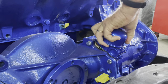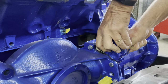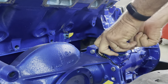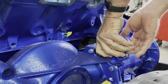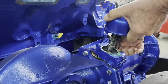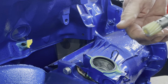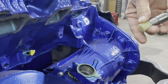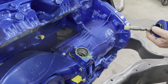You take this off and then you pull on this little booger. You need both ends — there we go. You pull it out, and there's the gear. Now this one's new. When we build a transmission, you've got to have a new governor gear. But if you did not know about that in a 425, you wouldn't replace it. So here's what it looks like.